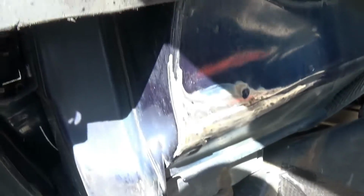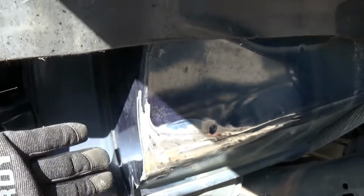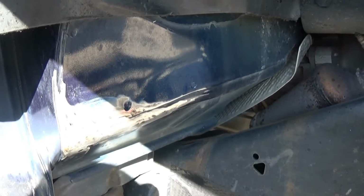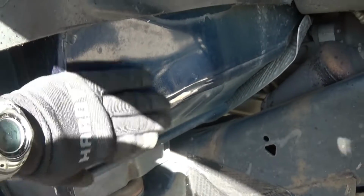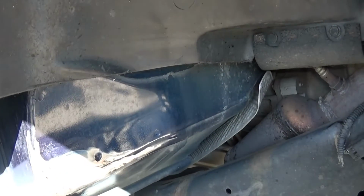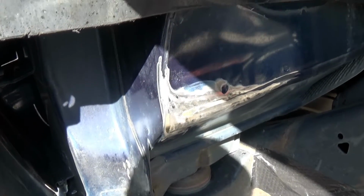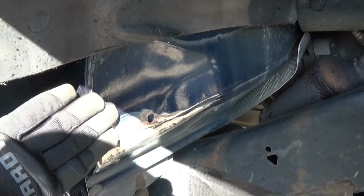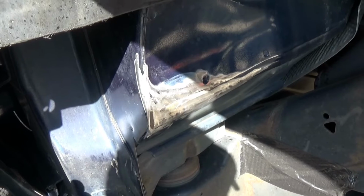We cut some of the laid over metal out, smoothed it down a bit. The plastic here, we cut straight across. My inner liner, you can see it. I haven't put that back in yet. We're going to doctor this area up a bit once we get the wheels fitted and test. We're not going to leave this like this, but we're going to get it on, get it doctored up, and that'll be another video probably on how we bandaged this up and made it look okay. And guys, you can do this without it looking bad really after you doctor it all up, and we're going to show you how to do that in a later video, so that'll be something to stay tuned to. But for now, I'm going to hit it with some primer and some rust protectant paint.